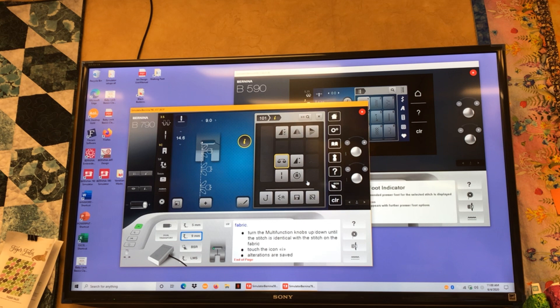That's your per-stitch option, so depending on what stitch you pick you have a bunch of setting options. I've changed this stitch a little — I can see it's yellow. Along the bottom we have four options: I can save that stitch, and every time I select the tulip it will be in what I've saved. If I sew it out on stable fabric and it doesn't look right, I just come back in and unsave it — that fast. There's also a reverse option: you can sew in continuous reverse by touching this button on the bottom. I had a customer do this with her straight stitch and save it, and we couldn't figure out why her machine only ran backwards — check settings anytime a machine is behaving strangely.